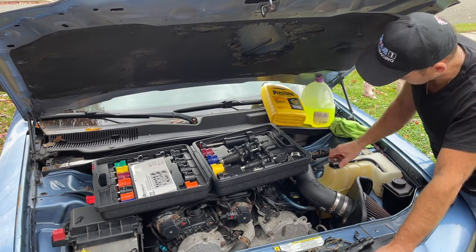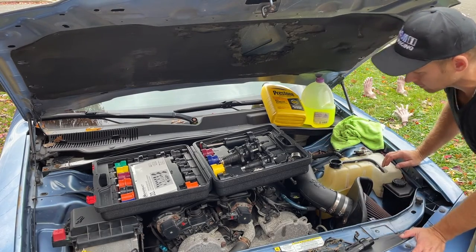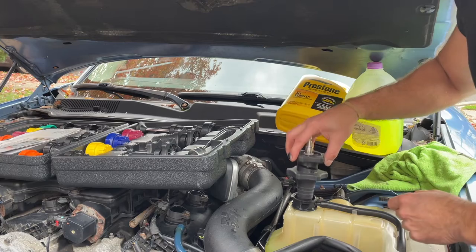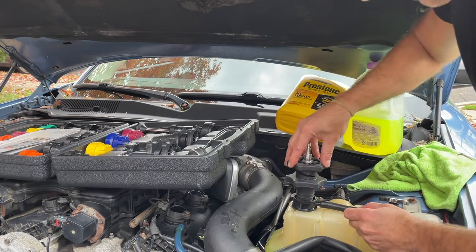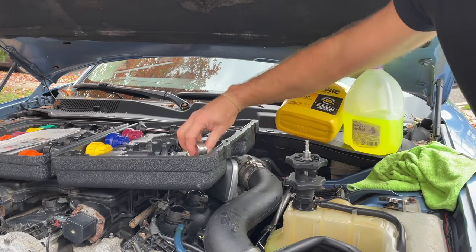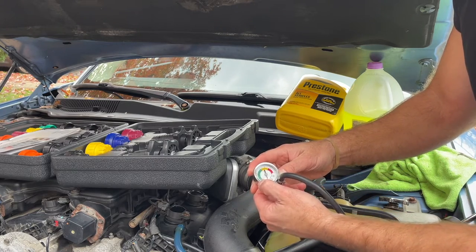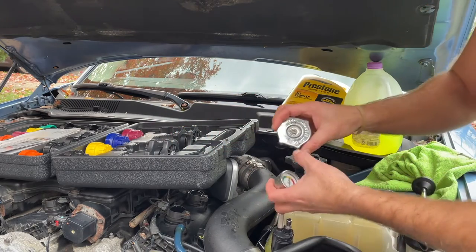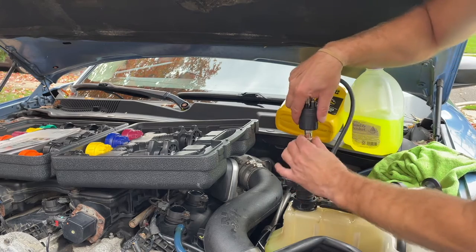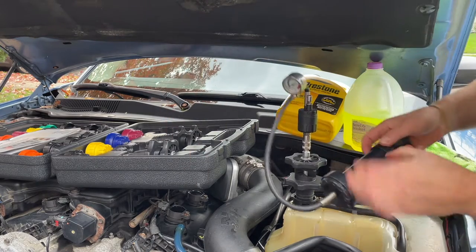My car is cooled down, so we're removing the cap — it's one turn, then a second turn. I'll give you guys a close-up view. I'm getting the universal adapter, making sure it's turned off and loose. I'm getting it as deep as I can in there — there are three different sizes but this one fits the best. Once I have it as deep as I can, I hold it down and give it a twist. Now it's secured and it's not going to come out. Second part is attaching the pump that you pressurize with. Most cars you pressurize up to 15 pounds of pressure. The system is rated at 18, so 15 is fine. This is a quick-release valve — you attach it here. Now we start pumping. You can start looking around for leaks even from this angle.